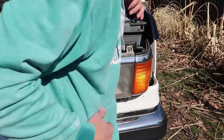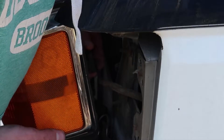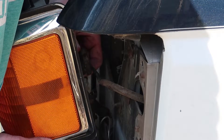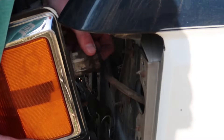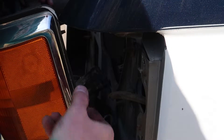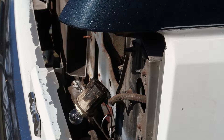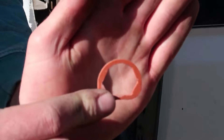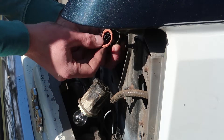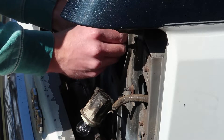The horn is also on this side apparently. So here's the plug — it's going to be back here, right here. So you're going to turn it gently — it should pop out. The plug turns this way, turns down the car, and the headlight assembly comes out on the ground. I dropped this little guy down in there — that sits on this, keeps the headlight sealed. So slide that back on there, and yeah, I'll show the video after I get done doing this.